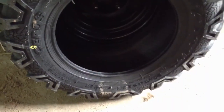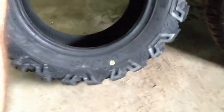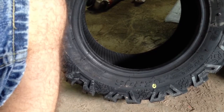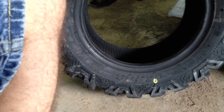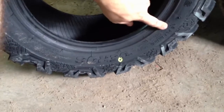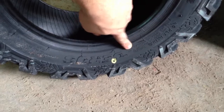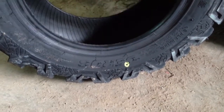These are radials — 6-ply radials. Should be a pretty good tire. They don't show the weight limit on it, but since it is a radial and it's 6-ply, I think it'll be good enough. The max UTV operating pressure is 18 PSI, so I'll probably run 18 PSI in them. They're quite a bit tougher tire.